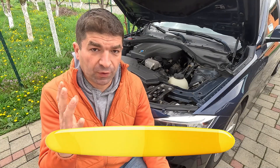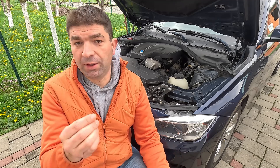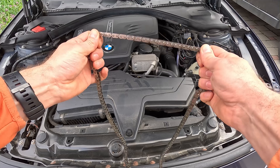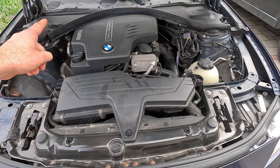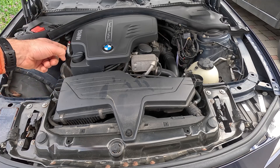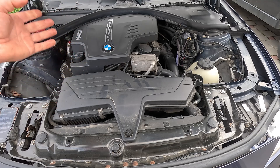While on the subject of camshafts, I must mention the timing chain, which links them to the crankshaft and synchronizes their movement. Unfortunately, these chains on most BMWs can stretch over time and misalign this connection. When the car's ECU notices this deviation through crank and camshaft position sensors, it'll trigger a limp-home mode and warn you with a drivetrain malfunction message.